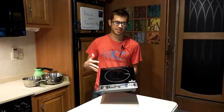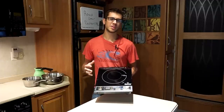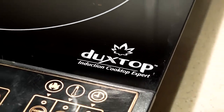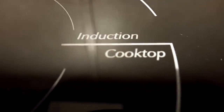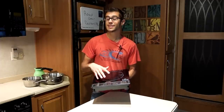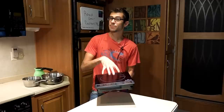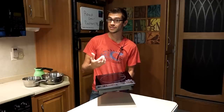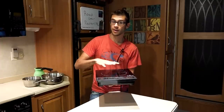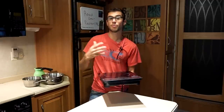This is basically a portable cooking surface — a single burner electric cooking device. What's great about this unit is it is an induction cooktop, which means the unit itself doesn't actually get hot. Instead of being a radiant heat source, it creates a magnetic field that induces a current into the pot. The resistance of the magnetic material in the pot slows that current and causes it to heat up, heating the pot indirectly without actually touching it. In fact, if you hover a pot over the top without touching it, the pot will still heat up.